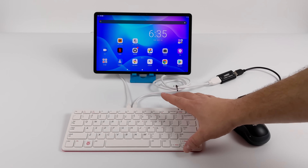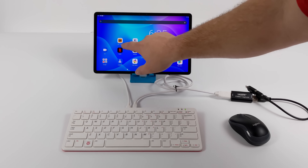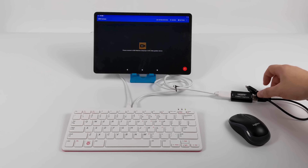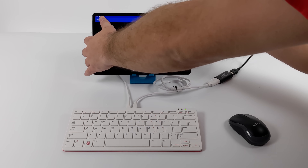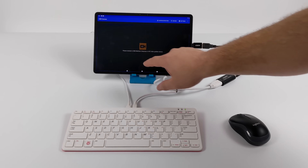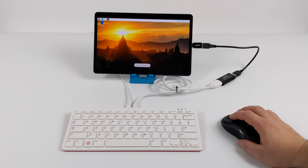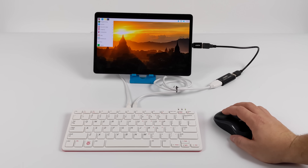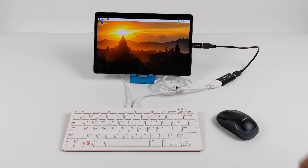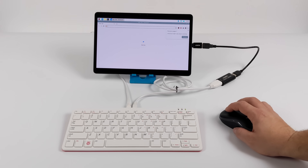Moving over to the Raspberry Pi 400 and the bigger screen. I have power into the Raspberry Pi 400, HDMI plugged in — it's all booted up and ready to go. I'm just going to plug this directly into the USB Type-C port on the tablet itself, start the app, and there we have it. Now I can use my tablet as a monitor for my Raspberry Pi when I'm on the go. And it does support sound — I'm going to go to a YouTube video and show you that sound is working through the tablet speaker over HDMI. So it's not just a video signal; we also have audio over HDMI to this Android device.